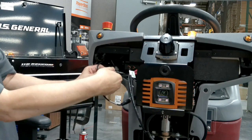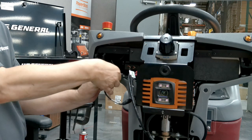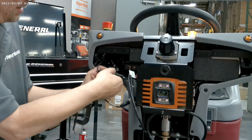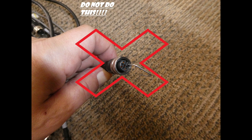If and when the numbers do match, move on to the next step, which will be to disconnect the modem from the upper trunk harness. Once you have the connector disconnected from the upper trunk, get out your multimeter and set it to DC voltage.